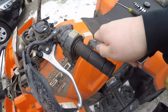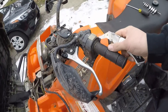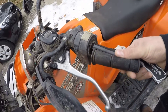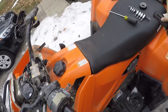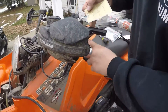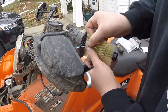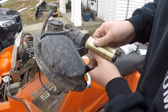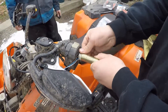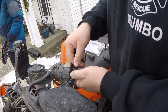You don't have to remove the hand grips with compressed air — we just didn't bother. For 20 bucks you could buy yourself a brand new set of grips that are going to be way more comfortable than the factory grips. Make sure there's no mud, dirt, or debris before you apply what is essentially a sticker — a sticky pad. Orientate your wires, brown, blue, and white, so they're facing towards the back. That gives you optimal length and placement so they're not going to flop around.